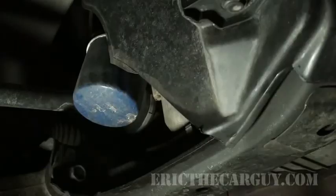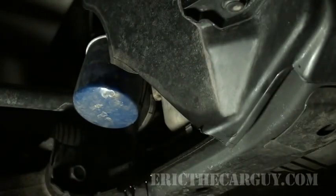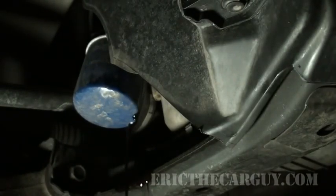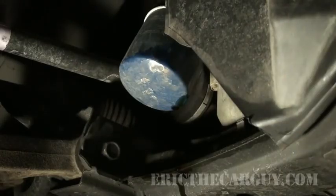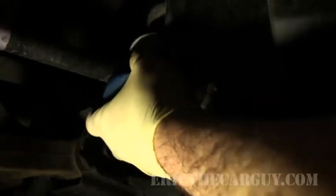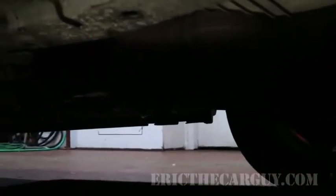Just going to let that drain for a while. Next, while this is draining, I'm going to take the oil filter loose. I did the oil change last time, so I know I'm just going to be able to twist this and it's going to come loose. Some oil may come draining out at the same time — just let it go ahead and drain. It's important to not tighten these filters so tight that you can't do this, but if you need a wrench, you need a wrench. Now that the filter is pretty much drained out, you can take it the rest of the way off. Then I just turn it upside down in the pan and let it drain out.